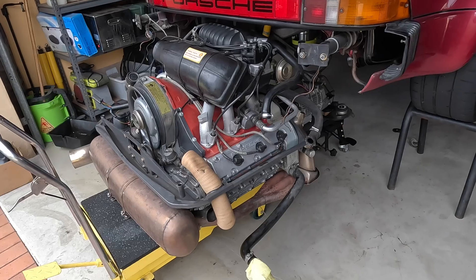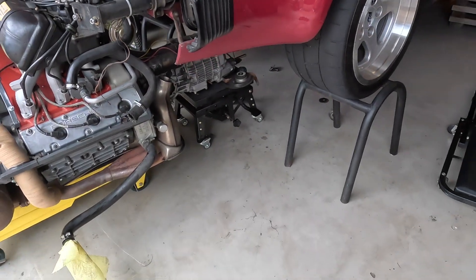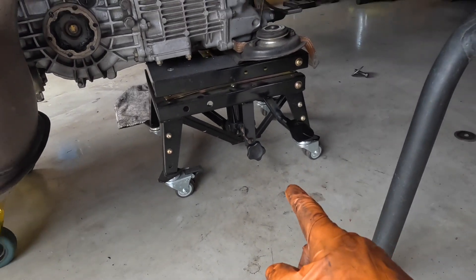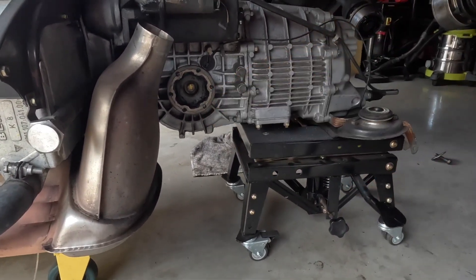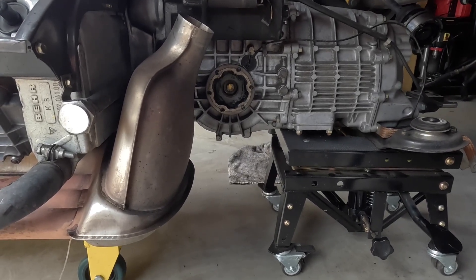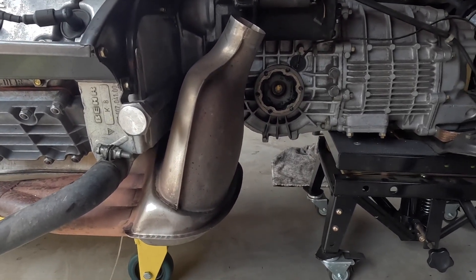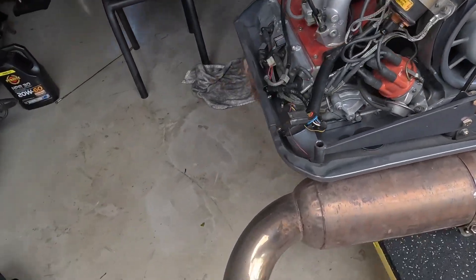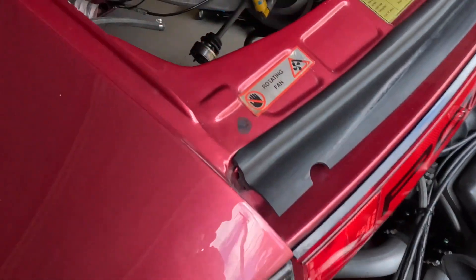20 minutes later and the engine and transmission is out of the car. Pretty straightforward using a hydraulic table and some stands to get the car up pretty high. I'm just using an adjustable hydraulic motorcycle lift to give me support underneath the transmission so I can change the angle when I want to get it out of the transmission tunnel nice and cleanly. The next step is to separate the transmission and get this up on a stand. Give you a look - you can see what sort of condition the motor is in, it's actually pretty nice. And there's my engine bay.